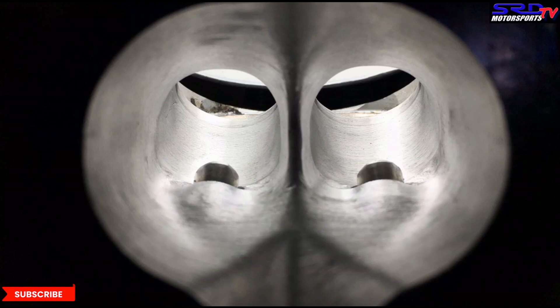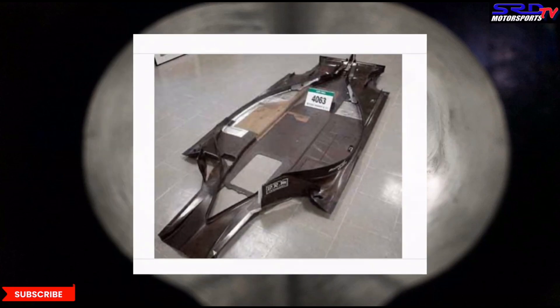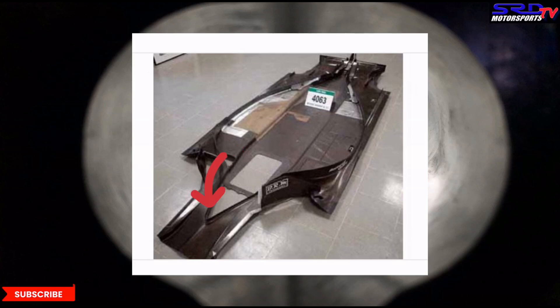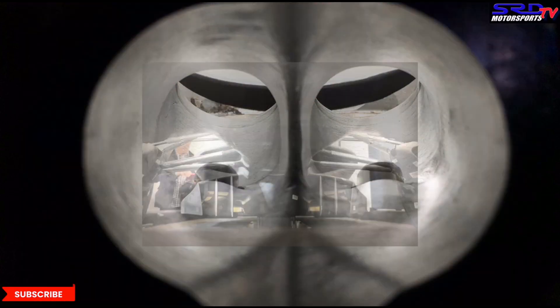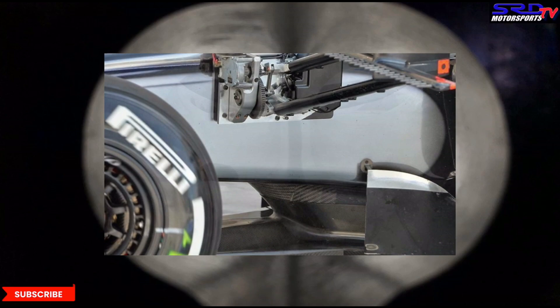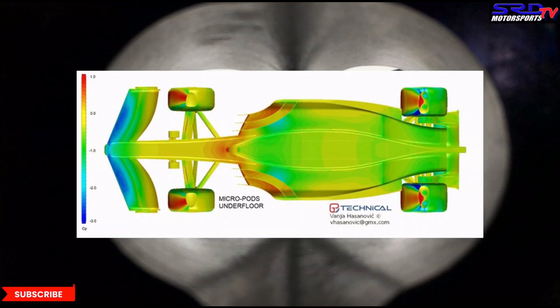Now onto the divider — some like the knife edge tip and some like to leave it round. I'm not debating which is better; there's more than one way to skin a cat. In Formula 1, this is called a tea tray — it starts the airflow towards the diffuser. The Caterham floor from 2015 shows a sharp divider. A more recent GP2 car and a McLaren during testing show a divider that is actually very round, as confirmed in simulation.